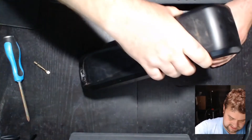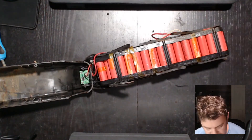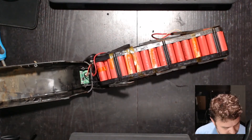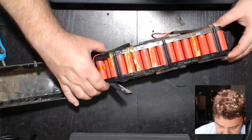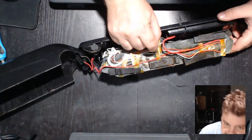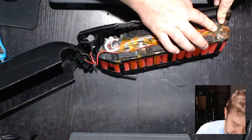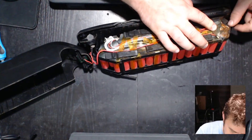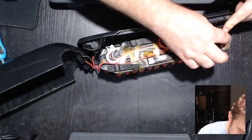It's out of there. You can see there's a substantial amount of water resting on this thing. I want to know how it looks under the cells — and I can tell already it does not look good. Let's take some of this tape off. You can see right there some of the rust spots. Take a look at this — it is horrific. I'm curious if this was nickel; they usually use pure nickel for these, so I'm guessing it was not.